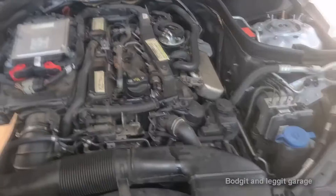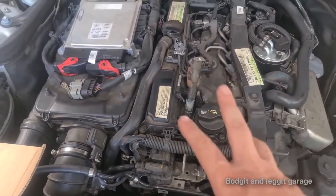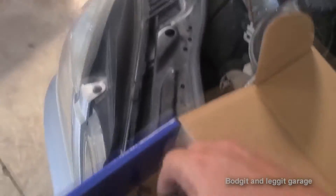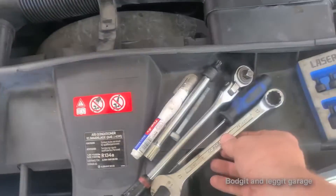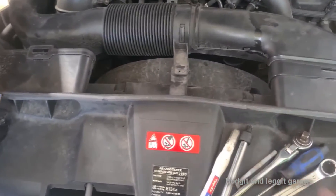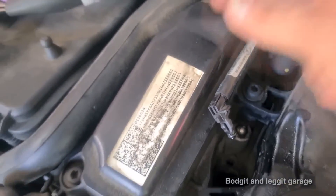The first ones came out really easy, so I want to show you the way I'm going to do it. I'm going to mark everything — I've got a little box here, I've marked the first pipe number one, I've marked the injector number one. All you need is a 17mm, a T47 Torx, some Tipex, and a screwdriver.